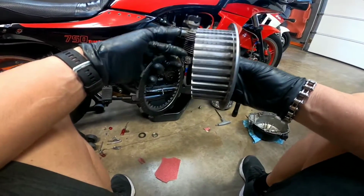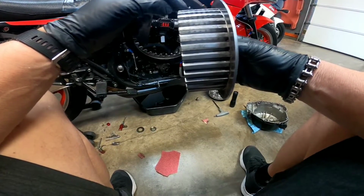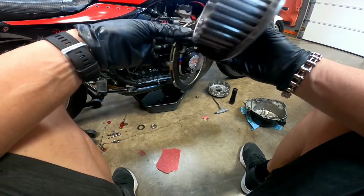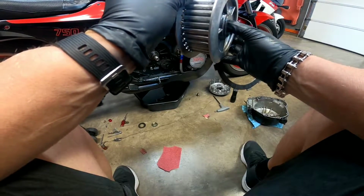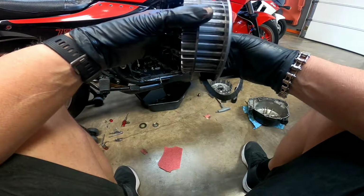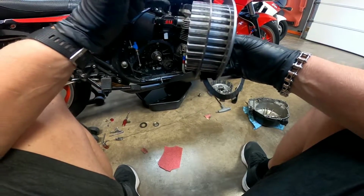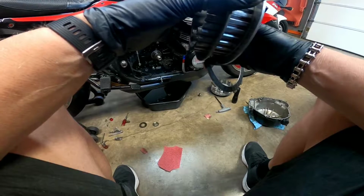I think if you look, there are like 34 years of grooves right here. Those little marks that you see, that's where these tangs on the steels, in any clutch, you've got fiber plates and then you've got steel plates in between them, are riding like this. So when you accelerate, this moves. When you decelerate, it goes back. So the whole time it's going like this, and these plates are causing little grooves.